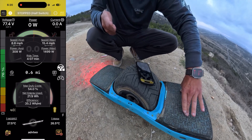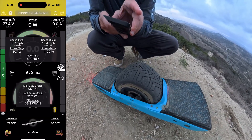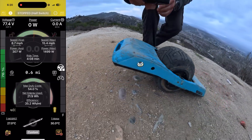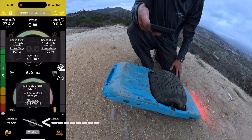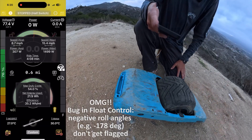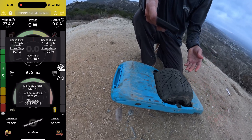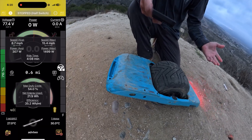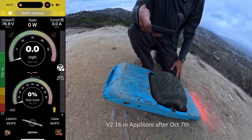The next reason why your board won't start even though your sensors are working is that the controller thinks the board is upside down, and the app will tell you that. We can see now that the board is reported as upside down, so even if I press those sensors it won't engage. If the board is upside down, that means your IMU hasn't been calibrated correctly — you've got to go back to that step. I also discovered a bug in Float Control while making this video, so look for the next version to have that issue fixed.